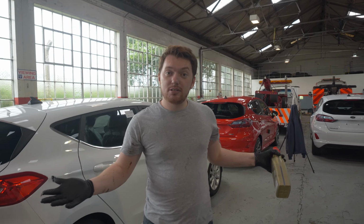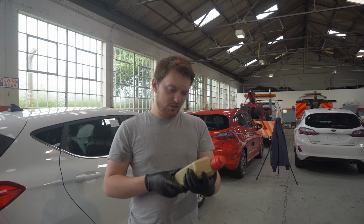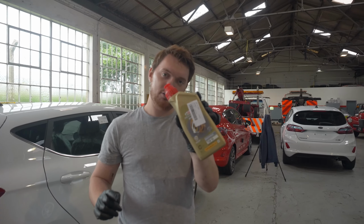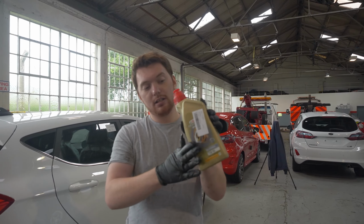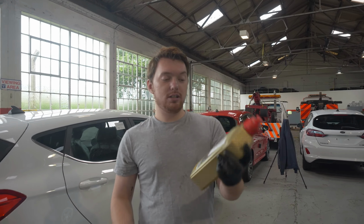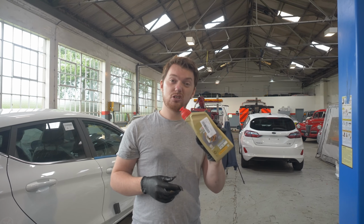Okay, so now that I'm completely covered in gearbox oil, this is what we're going to be replacing it with. We're replacing it with Castrol. I think it's like Transmax manual. It's 75W90. So for anyone that's watching this wondering how to do a gearbox oil change on a 944, that's what apparently you need, according to many sources on the internet. So I believe it's only about a litre or so that you have to put into this. Don't confirm on that. I'll put it on screen exactly how much you need, but we're going to find out the hard way, because pretty much you fill it up until it's just at the top of the filler plug area. So hopefully should go okay.